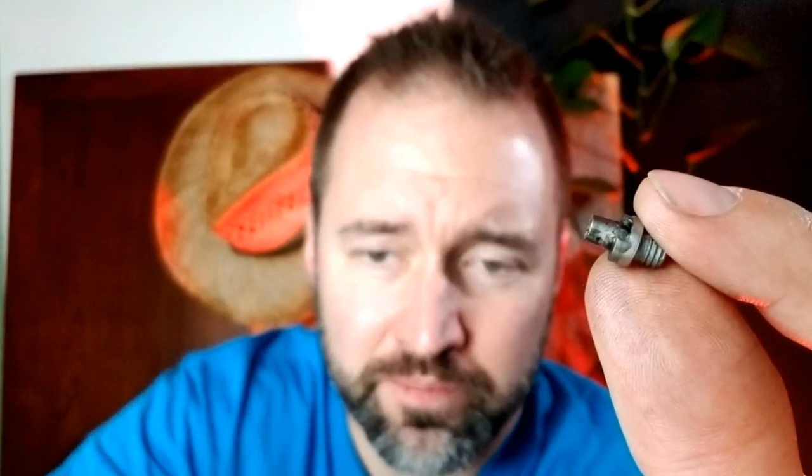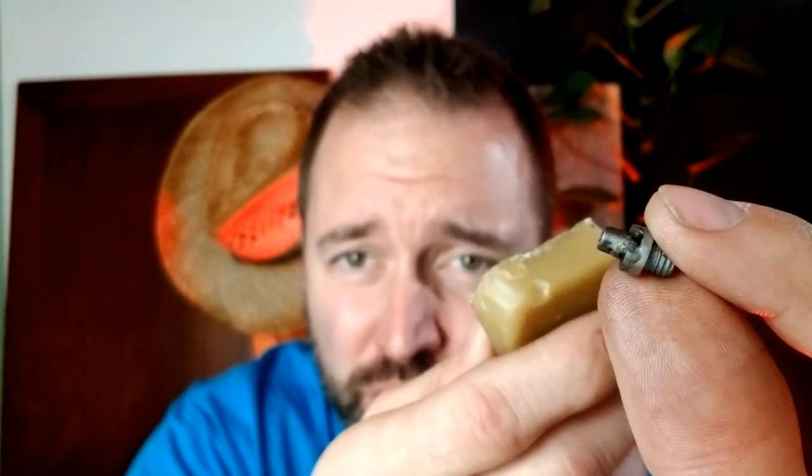You're going to need either the factory nipples or cones, or Slick Shot nipples or cones. I used 12 Remington number 10 caps with the factory nipples, 12 CCI number 11s with the factory nipples, and 12 CCI number 11s with the Slick Shot nipples. Take a nipple wrench — this one's from Track of the Wolf — and remove each and every one of the nipples from the cylinder.